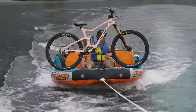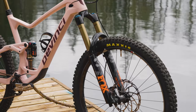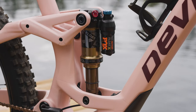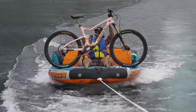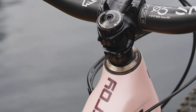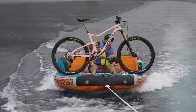For suspension I'm running a 160mm Fox 38 in the front and a Fox Float X in the back for that buttery smooth ride like you're floating on water. For the fork I run 110 PSI and three tokens, and in the shock I'm running about 205 and one token. The dropper post is taken care of by a 200mm Fox Transfer post. I run a Wolf Tooth premium headset in the espresso colorway — an absolute work of art. Bearings come out at the end of the season running like new. Love this thing.